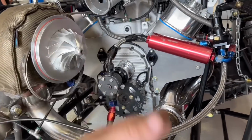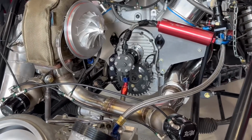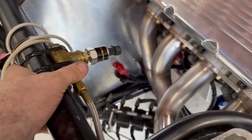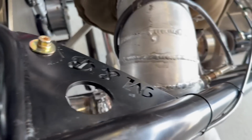And it's all about the camshaft. All that stuff plays a difference. So you've got to really start looking, and you've got to monitor. Something I did not tell y'all earlier, I told y'all we got the Scarlett Solutions. This is our back pressure sensor, but I did not tell you why it was in this plumbing tee. It's in this plumbing tee because you have pulses, and this is where it goes on the turbine housing. So we drilled it and tapped it, so that's where it goes there.